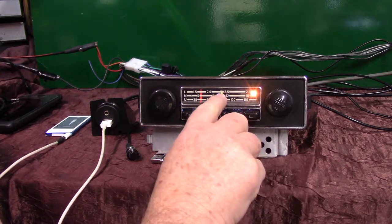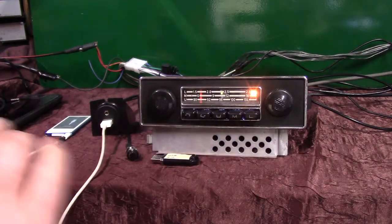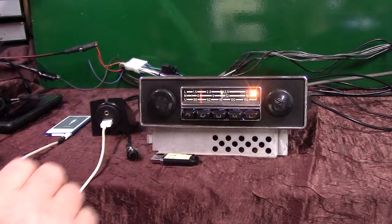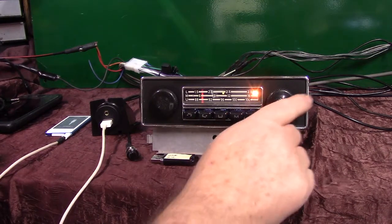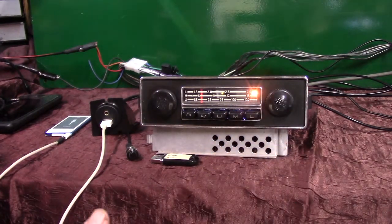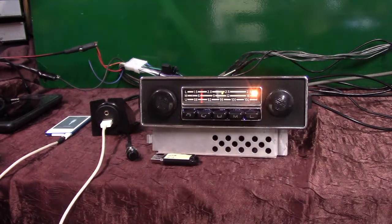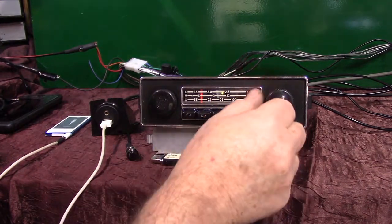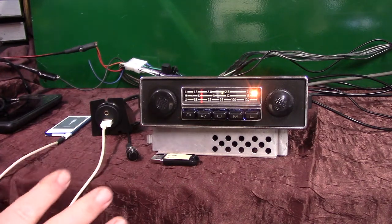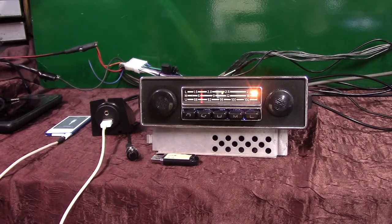You've got a little operating LED back here in the background — that's where there used to be the original light, and it showed up in red when you cut the radio on. Over here you've got a stereo LED; he wanted an amber in it. That used to be the trimmer — you'd stick a screwdriver in there and adjust your trimmer. You don't need that on these new radio conversions. They do not require 12-volt constant. There's no hot wire that you have to do, no memory, no battery changing. It's a pretty cool radio.